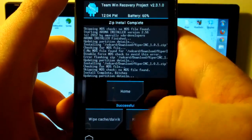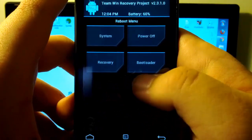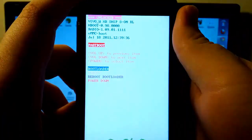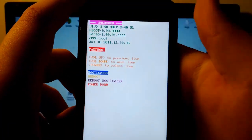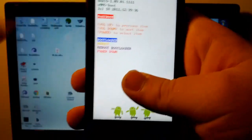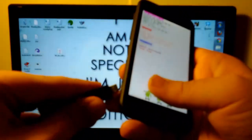That was really quick. So we are going to go back home, go to Reboot and Reboot Bootloader. I am HTC Dev Unlocked — I am not S-off. If you are S-off, you can just reboot the system there. Reboot into the bootloader. I'm going to take my USB cable and plug it back in. We are in Fastboot USB once more.